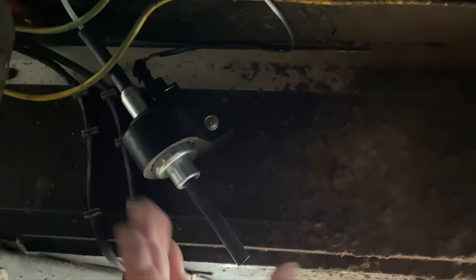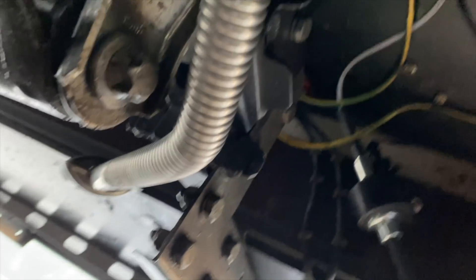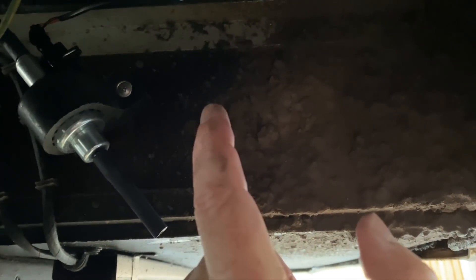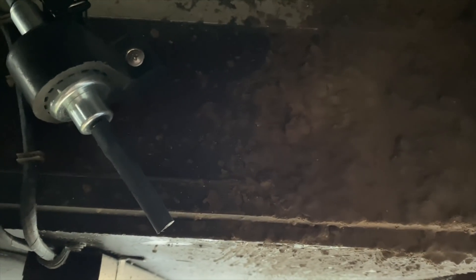I've got my fuel pump in at the apparently optimal angle of 45 degrees. The exhaust is done including the silencer, which runs down towards the back of the van. The air intake is off to the side, completely separated from the exhaust, so there's less chance of the air intake picking up fumes. I haven't powered everything up yet because I wanted to make sure all the installation was done so that the first time it powered up it had fuel and everything was ready to go.